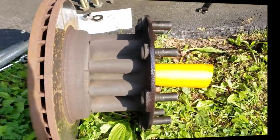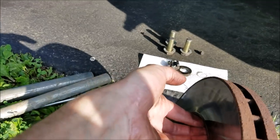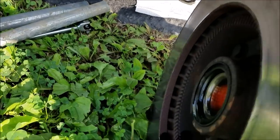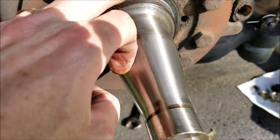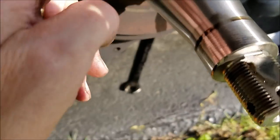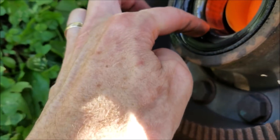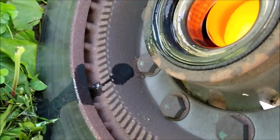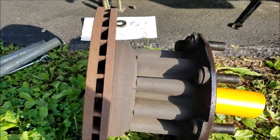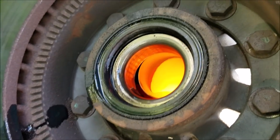I've got the big nut and washer — came right off real easy. Here's the bearing; it looks really good. I'll clean them up with some gasoline and inspect them. When I was reading the repair manual, it mentioned some special sleeve for protection as you pull this off — I guess so it doesn't ding the surface as you slide it off. I don't have the special tool, so I'm going to make one — I got my wife's cutting board, these little plastic things. I'll roll it up and slide it in there to protect that shaft. Just don't tell her until I've done this.